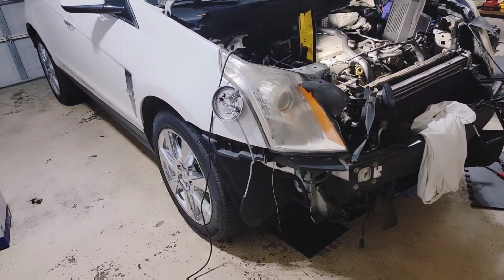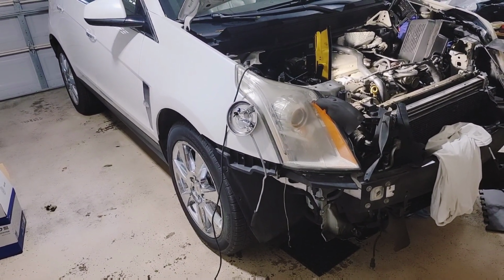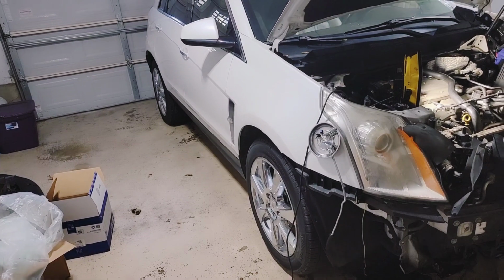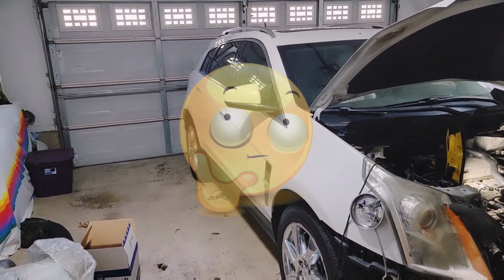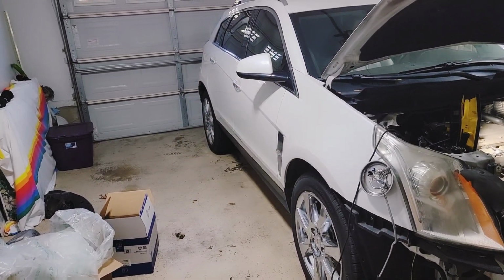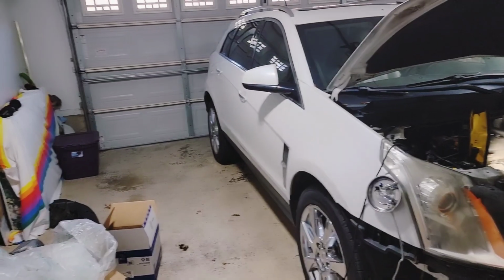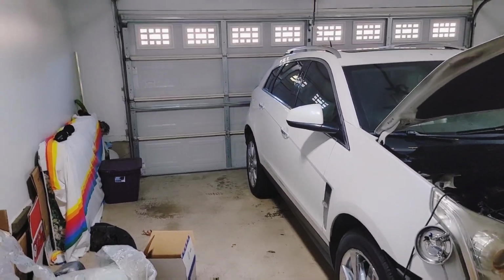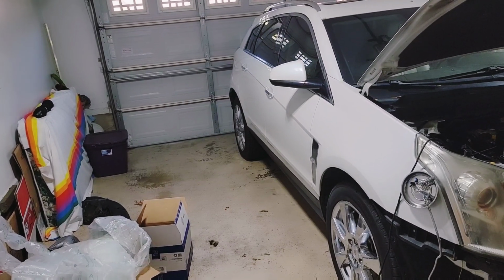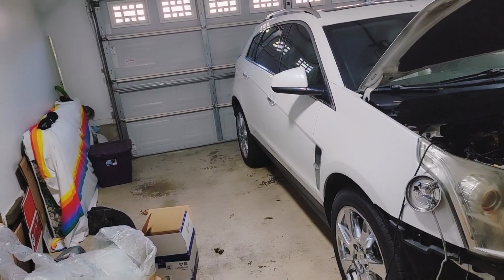but I have changed all of the wheel bearings. Front, very simple, came right off. Back, I literally split the CV axles trying to get the bearing off. It just will not come off, but it was fine because I kind of wanted to change that stuff anyway, so I changed the rear axles. I had to take the whole knuckle off in the back and get those done, but definitely worth it because they were all bad. Car sounded horrible. It was extremely loud. Couldn't even talk on the phone while in the car because you couldn't hear anything, and vice versa.